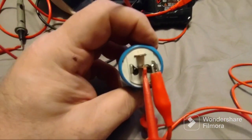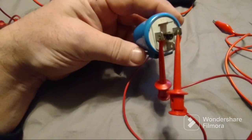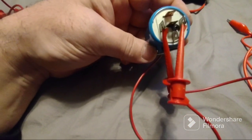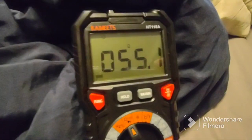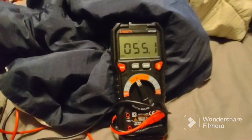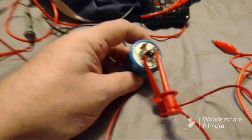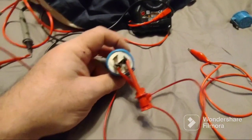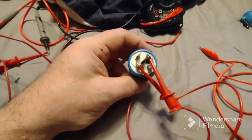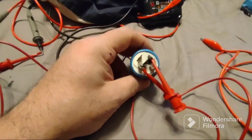The whole reason for all this testing - the first thing you want to do when testing a relay is test the coil resistance. Put your meter on ohms and connect your leads from 86 to 85. On these Lucas relays they're usually around 52 to 55 ohms. We have a beautiful 55-ohm reading on this coil. Just because your coil is good doesn't mean your relay is good - contacts could be dirty, carbonized, or corroded, so even though you hear the relay clicking it doesn't mean it's making contact.